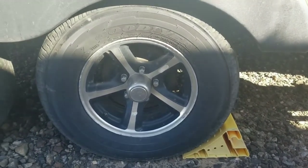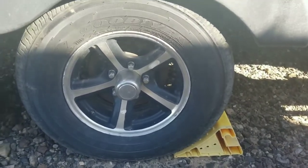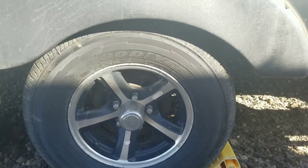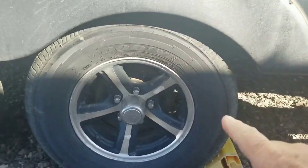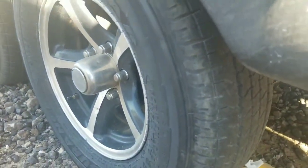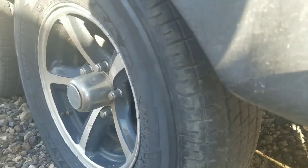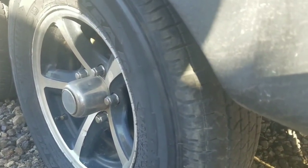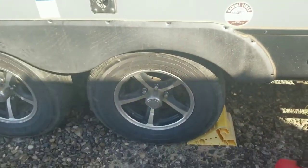Tires are another important fall inspection you should make. Not only are you concerned with weather checking around the sidewalls on the outside, be sure to inspect between the treads, because a lot of times you will get cracking between the tread lines, which indicates dry rot, and your tires will fail on you unexpectedly.